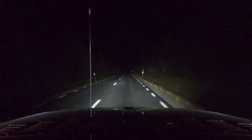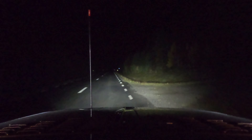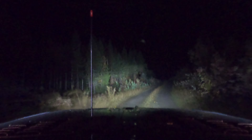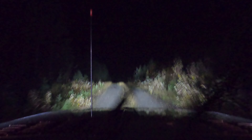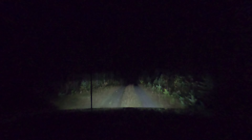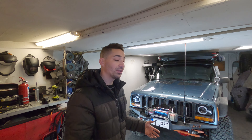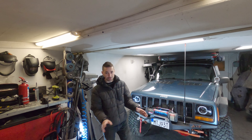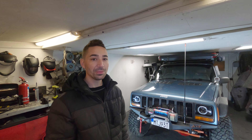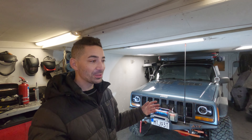In terms of how the lights perform as ditch lights or cube lights, when there's fog, extra lights like this are pretty bad — you've got to switch them off or have proper fog lights. But when the road's clear and you need some visibility from the sides and a little further down the road, they're performing really well. I've had a few variations of ditch lights on the Jeep — some cheapo ones off eBay, bigger ones that cost quite a bit — and there was always a lot of hood glare, which there isn't with these. Because it's a focused beam there's not much hood glare at all and it doesn't distract you from driving. They're bright too, about 8,000 lumens — shining straight down the road giving me a little bit of extra visibility.